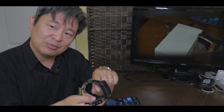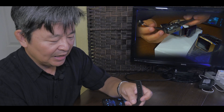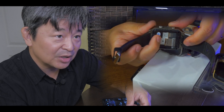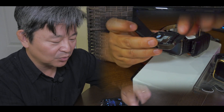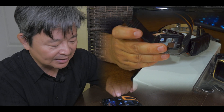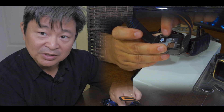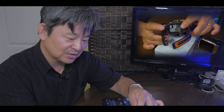Let me show you the inside. Here's the inside of this smartwatch. If you look carefully, there is the positive and negative terminal. This watch actually has a very tiny one, so it's going to be hard to solder in. Basically you have a positive and negative terminal and you hook up your battery that way — positive goes with positive, negative goes with negative. Now, some smartwatches also have a third terminal for voltage regulation, so make sure you wire that one too. Usually it's black for negative, red for positive, and yellow is the voltage regulator, usually found in the middle. Make sure you know what you're doing — I wouldn't recommend it if you don't, as you can ruin a hundred-dollar smartwatch.